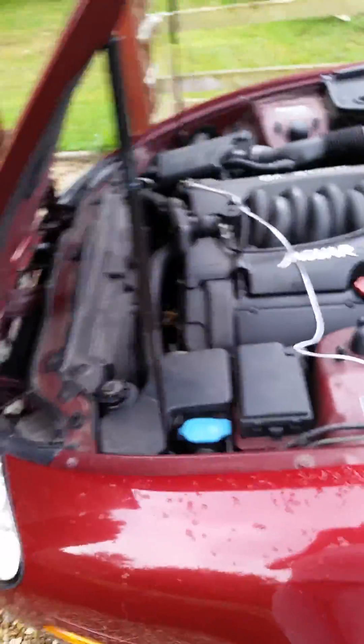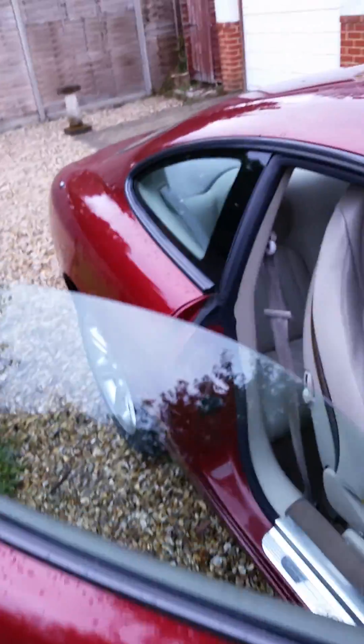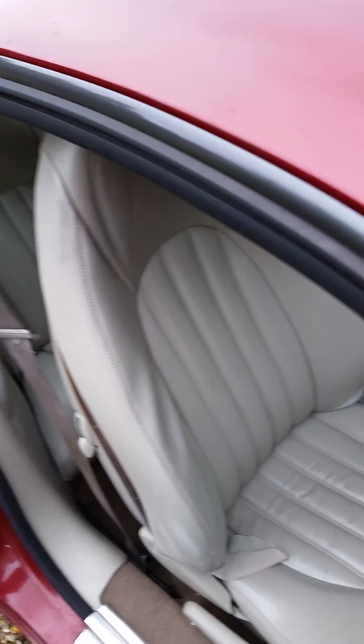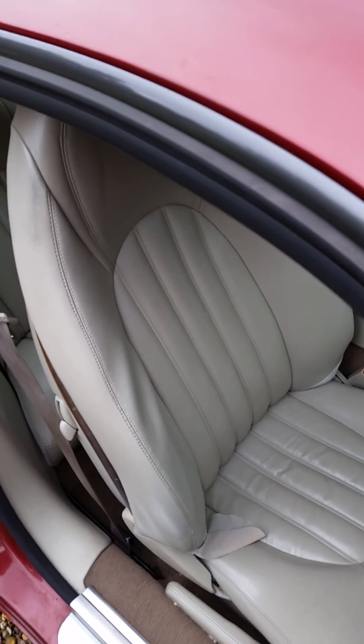If I just put a little bit of power, you may be able to hear it operate. OK, so that's operating my VVT solenoid. Now if I start the engine and let the engine settle and rattle, we'll then operate the solenoid while the engine's idling and see what changes.